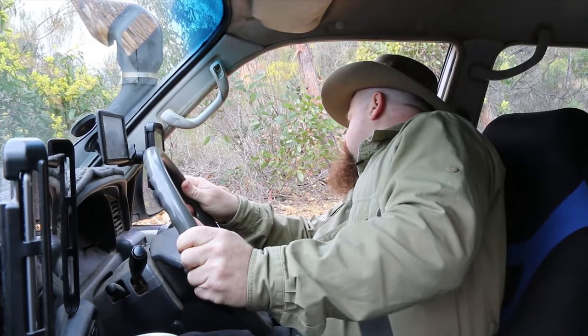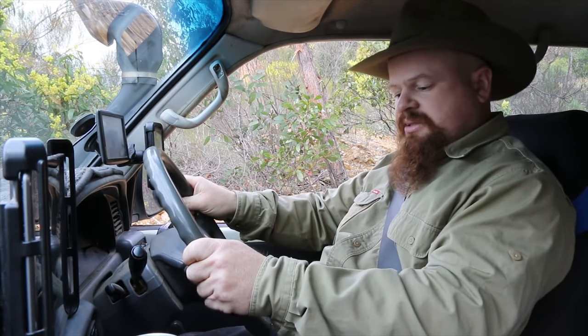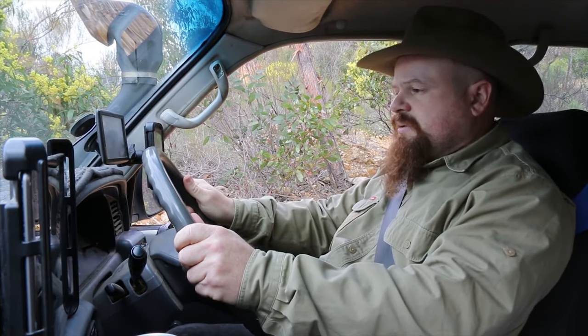We're ready to head back down the hill. I can see where my wheels are pointing - I can go by my emblem also. Prepare to head back down: slowly disengage the clutch, pop it in reverse - very last time I have to touch the clutch. Disengage the park brake, and then very slowly disengage your foot brake until we're resting on the compression of the engine.